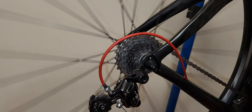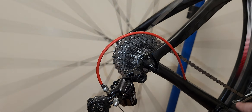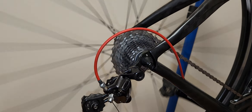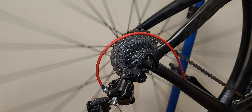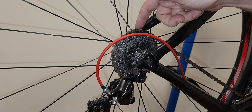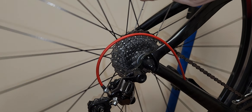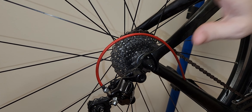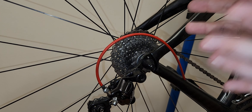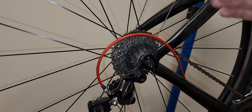So I'm going to start shifting now. I'm going up — very gently, you don't want that chain to go all the way down. Let's stop this wheel. I'm trying to push it with my thumb to see if it's going to fall on the other side, because if that happens, it's going to destroy my spokes — all the spokes are going to be chewed up and will have to be redone, which is pretty pricey. At the same time, the chain may suck into my rear derailleur and even break it off. But you can see it's operating correctly — it's adjusted properly and it's not going to fall on the other side.